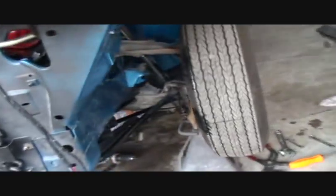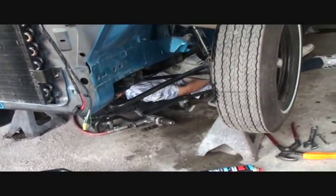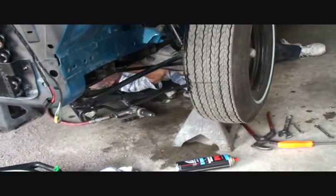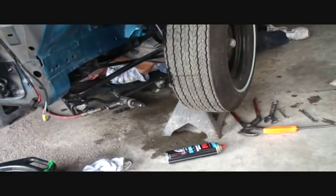What's the situation, Chad? What happened? Hold on. Got a problem down here. What's up, Phil? I had to drill a hole in the transmission case to stop the crack. You drilled a hole in the transmission case? What are you going to do, weld it up? No, it just stopped the crack.